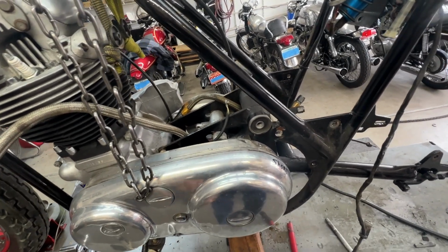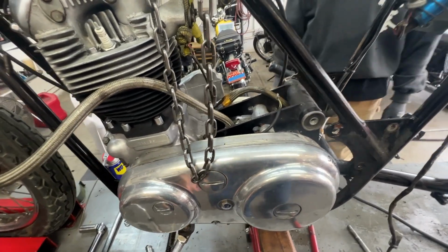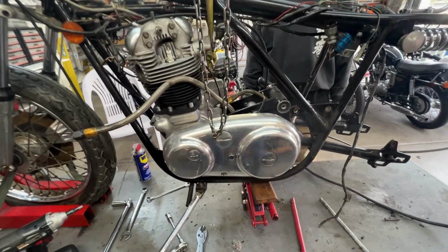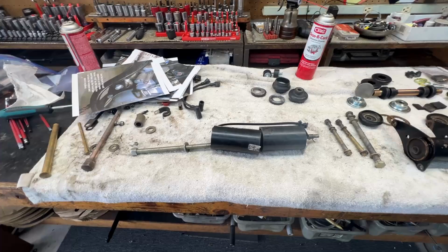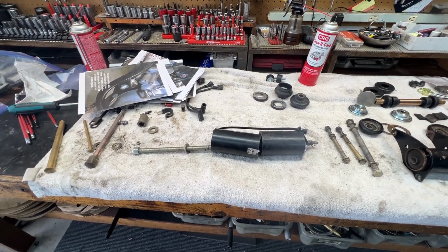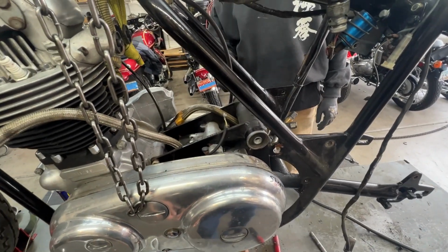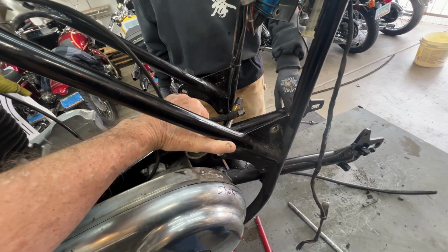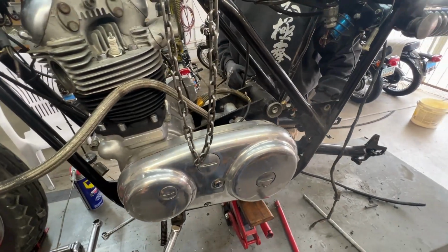This is a deviation from the photographs that I published yesterday because that bike didn't have the primary on it. That was 10 years ago, and I don't remember why the primary wasn't on it. So I assumed that this time the primary had to come off. Apparently it doesn't. So here we are. We got this visible, and we have the tool here, the Yonder ISO puller tool, and we're going to try to pull that ISO out of the bike towards Kevin on the right-hand side and see how it goes. We need to get enough clearance around these eyelets to pull it out and then push the new one in. So, getting set up. Here we go.